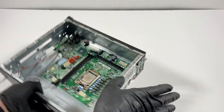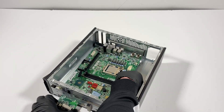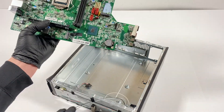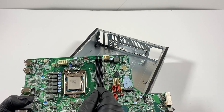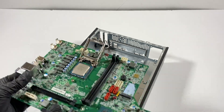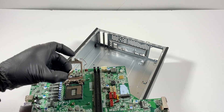Okay so I can pull the motherboard out like this. You've got to lift it up like that, and when the motherboard comes out like this — here's the motherboard. The last part is I'm going to remove the CPU. It's got an Intel Core i5 11th gen. Gently like this — and there's the CPU.